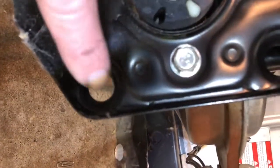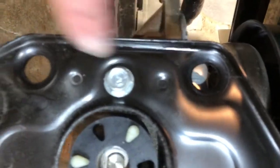We're going to put the rubber piece so that one of the openings in the rubber is pointing toward 12 o'clock. And then on the motor, we're going to make the top part of the fork point toward 12 o'clock. And we make sure these rubber grommets are all in place. And the one in the transmission, we want it to point towards 6 o'clock so they can match up.